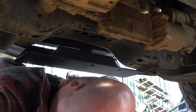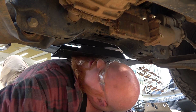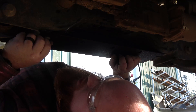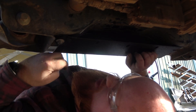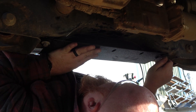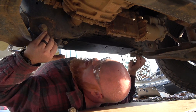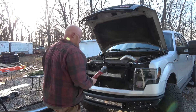They'll slide right out of the frame — put it in right there, you can hear it snap. Just make sure it's centered. Now I can feel around and get these 13mm bolts. Pick up the bracket — actually it flips around so it hooks on the side, and it does what us country boys call 'sandwiches it.' We're just loosely putting all these on because we don't know if the bumper is side to side correct yet. We'll go back to the front, move the bumper where it needs to go, tighten the front bumper mounts first, then draw the rear up with these.